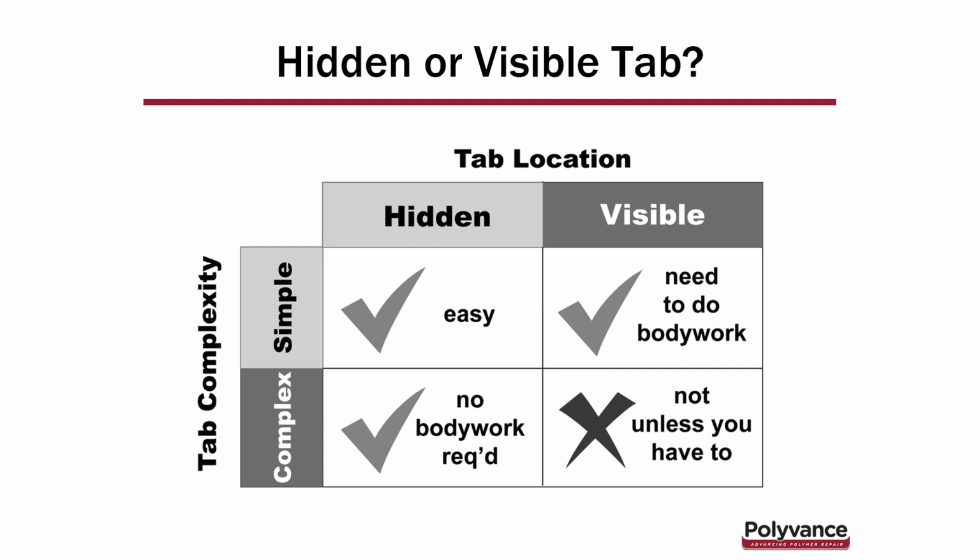Things are more difficult when the tab is visible. If you have a simple tab that is visible, you're going to need to do some body work. It's typical body work: sanding, priming, filling, sanding, priming, filling, and so forth until you have the look that you want. It's just on a much smaller scale. It's not difficult to do, but it does take time to do the cosmetics on those